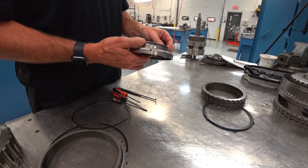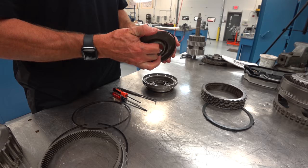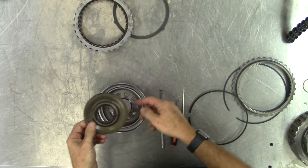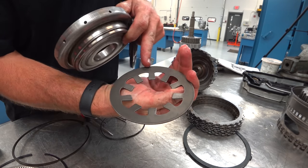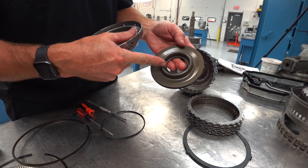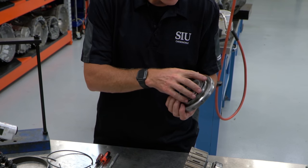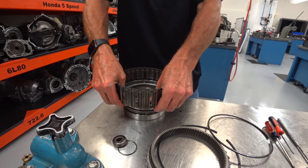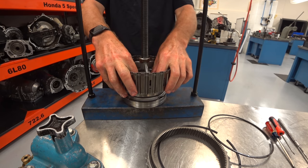The K2 piston itself has a big O-ring on the back — change it out. In the middle we've got the balance piston with a big O-ring. It doesn't have an O-ring on the inside because fluid is designed to kind of leak out through there. On this piston there's a diaphragm spring — the outer edge contacts a raised section on the K2 piston, and the fingers contact the balance piston. Nothing wrong with this setup, so I'll put it back together, being careful not to lose this big O-ring which doesn't really sit in a proper groove. Gingerly press the whole assembly in.